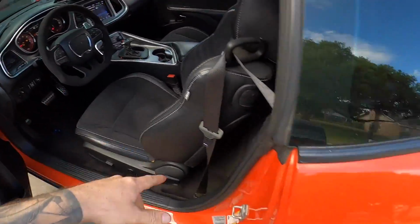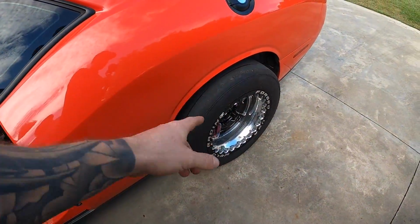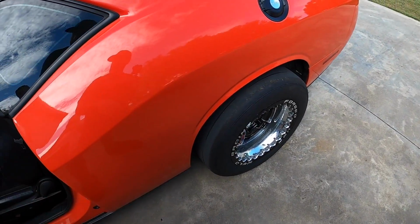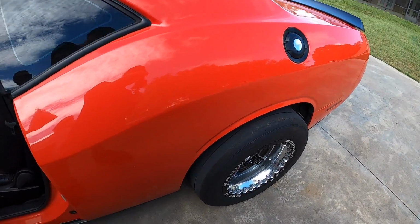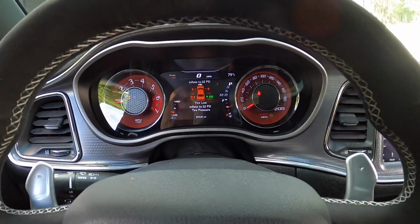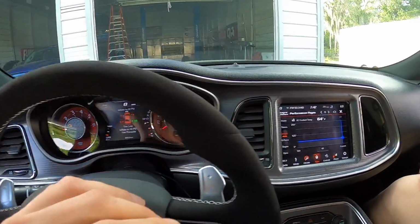All right, so it was mad because of a wheel speed sensor back here. I actually remember this one, but because we had this all apart, I just got to tighten that up a little bit. It's on there, but it just needs to be snugged up a bit, and then it should be happy again. All right, so we are back in business. We got all the ABS lights and all that stuff cleared.